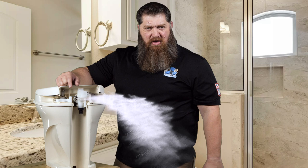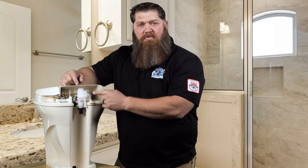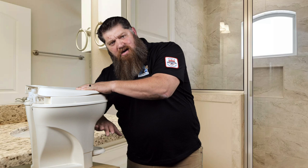Just know that this is here, and if we winterize, whenever we're running our food grade antifreeze through there, we hold this down till the pink comes out. Once we got pink water, go ahead and close it.